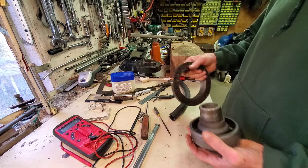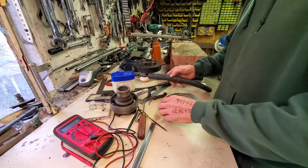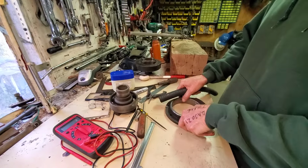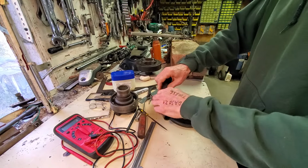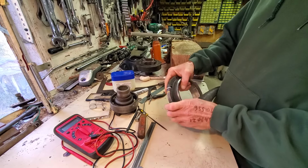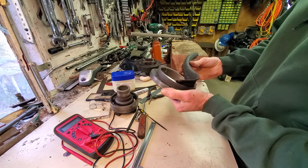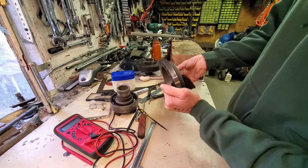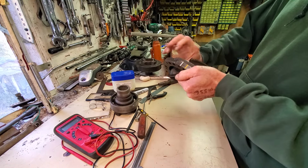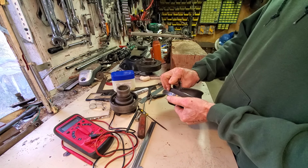But let me get my rubber staged up and woven on here. I've got some timing marks. That's 0 and that's 10 degrees. I'll fold the rubber hose backwards. I'm going to actually try to target having my rubber gap right at 0 as well, just for no other purpose than attention to detail. Some degree of useless uniformity.